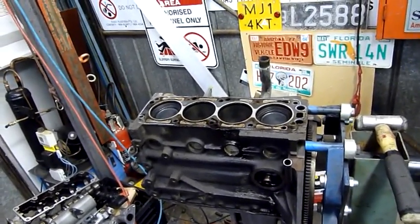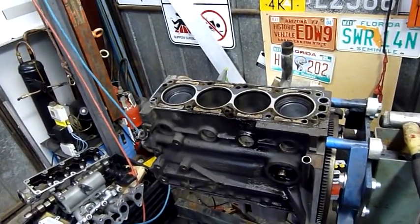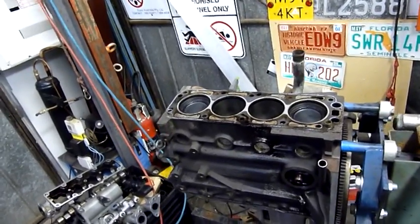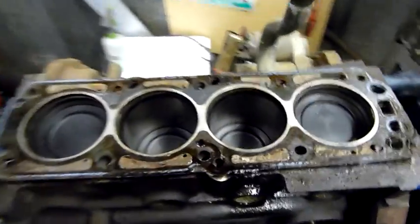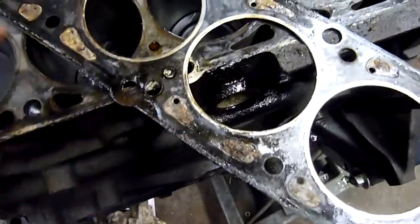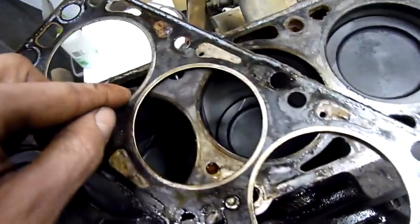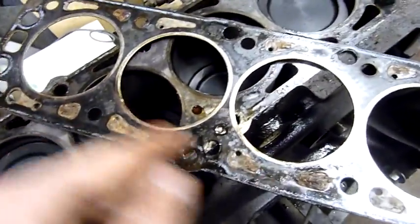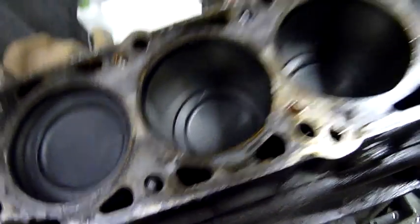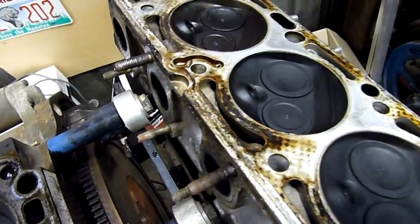I was quite impressed with how much it put up with and it still kept going. I think the only reason it stopped working properly was compression loss and spark plug fouling. Even though I was burning Jet A1, it was still using the spark plugs most of the time - only when I got it really hot was I able to disconnect the coils and have it run on its own. Looking at the underside of the head gasket - there's a lot of leakage signs and goop around the front of these two cylinders, the rest of it seems to have held up. It's just blowing through here near the high pressure oil gallery - particularly there, which would be cylinder number three from the back.